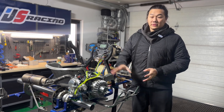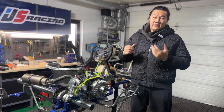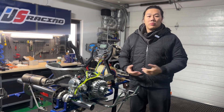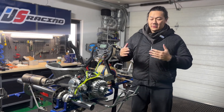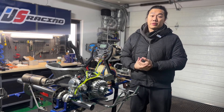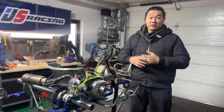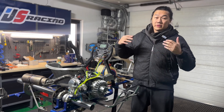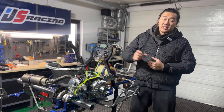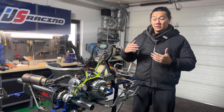To explain the crankcase-to-cylinder-head upgrade: imagine pumping air into a flat tire with a hand pump — the more you pump, the more resistance you feel. That's essentially the same thing happening inside the crankcase, but the crankcase gets very hot, so the air pressure in there gets very large. As the piston moves down, there's a bunch of high-pressure air trying to push it back up — an opposing force constantly working against the piston's movement, making the engine's life a lot harder.